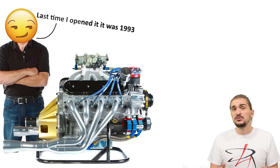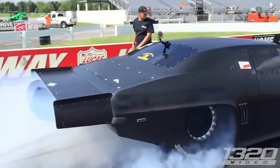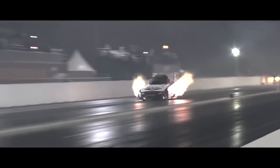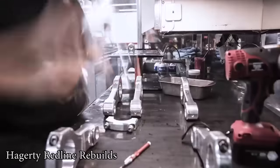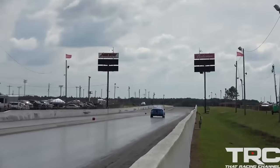The benefits of aluminum rods are actually only realized under full engine load, and street motors spend only a fraction of their time under full engine load. This is why we see aluminum rods mostly in drag racing — the ideal environment for them. During a drag race, the engine is loaded fully for a short period, harnessing all the benefits while giving the rods minimal stress because the race doesn't last long. Most serious drag racers open up their engines and inspect them pretty often anyway, making drag racing the optimal application for aluminum rods.